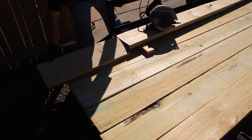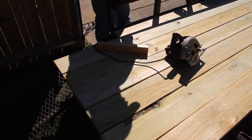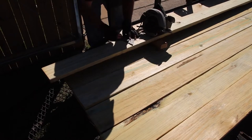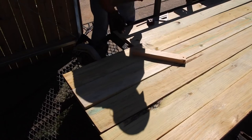My process here was to have all the boards on the trailer in one place so I'm not going back and forth. I'll prop each board up on a piece of scrap 2x4, measure, strike a line, and cut the end off so I've got the right length board.